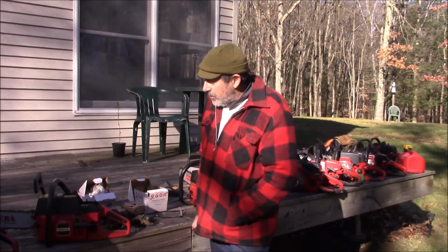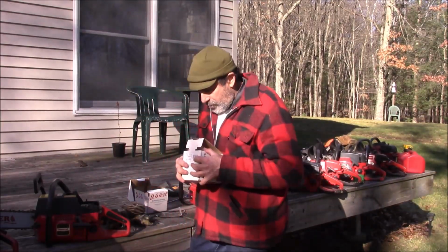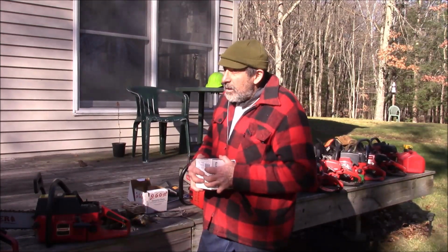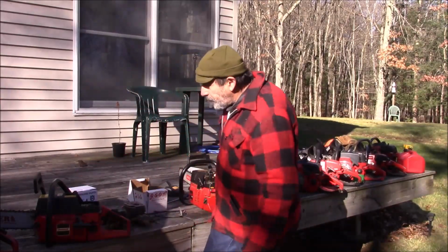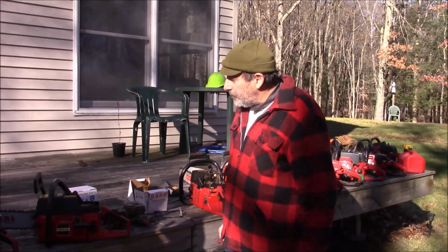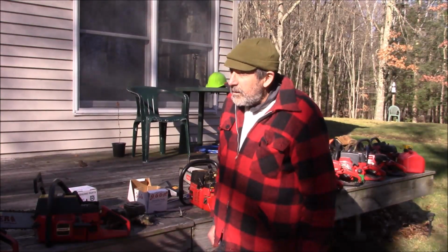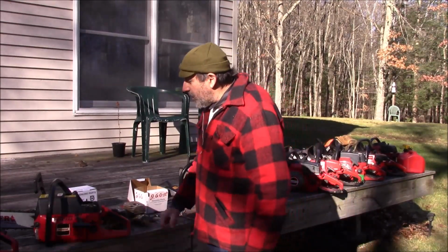I think part of it is, and this is going to be in the weeds, and then we can get along and start cutting, the open port piston casting is actually one part of the actual channel. They've actually cast in the basic transfer port; the piston is one half of the transfer port. Where on the closed port, you have a windowed piston, but the transfer port's totally enclosed within the casting itself. That's weeds. Anyway, to me, it's not a big deal.